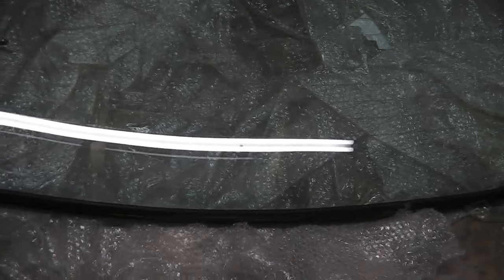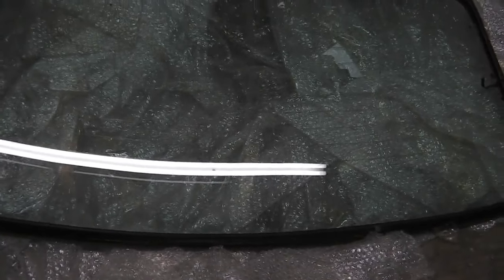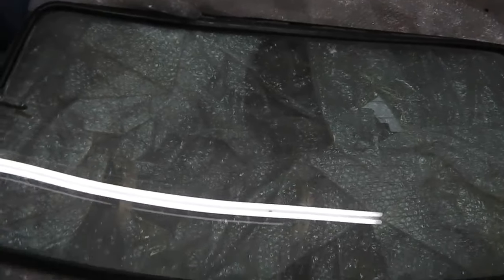So we're going to place the dealer sticker in so it's done and out of the way, after we've already cleaned the glass. I'm also going to check the electrical connections. It's initially looking okay on the meter reading. It's showing me a resistance across there, so at least some of those tracks will be all right. But we're going to check them all anyway with continuity.